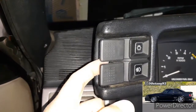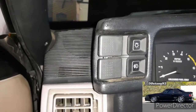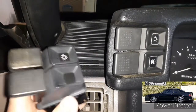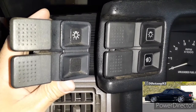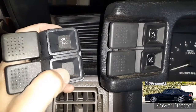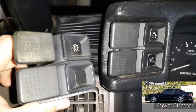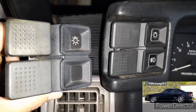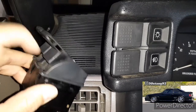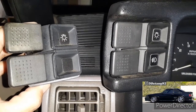This switch is the one for the GTs that have fog lights because you can press the fog light button. The old one I had came from the junkyard off a Mustang LX, which doesn't have fog lights. As you can see comparing the two, the top button has the light picture but the bottom one doesn't have the fog light picture like the new one. If you try to get these from the junkyard, make sure the switch pushes down if you have fog lights — the LX switch doesn't push down because it wasn't made for the GT.